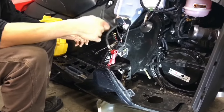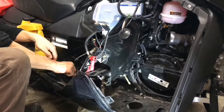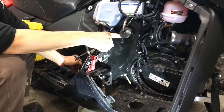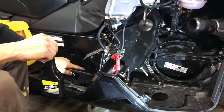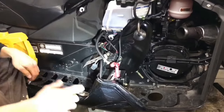Now that I've tightened all my bolts, there's the filler cap — or the overflow cap, you would call it. Because once you fill in your oil from here, it's gonna seep down. And once it starts running out of here, that means it's full. Do not put any more than this.